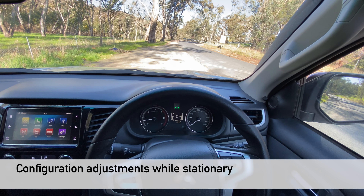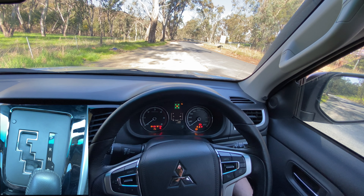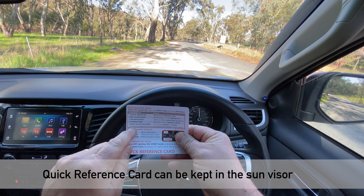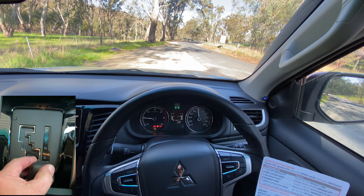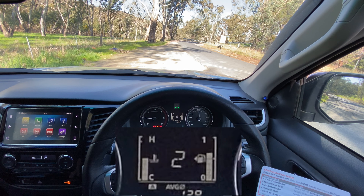To access settings: turn the ignition off, put the car into sport mode, turn the ignition on, and then press the LED once. The instrument cluster now displays an interface to change the settings, and you use the plus and minus of the shift lever to adjust. It comes with a quick reference card listing the various parameters. The first parameter is lock-up sensitivity — to adjust it, if you want it to hold longer before it unlocks, pull the lever to minus, say to 90, or go back to 100 which is the default.